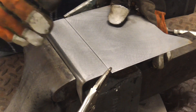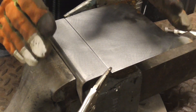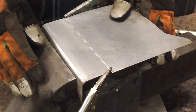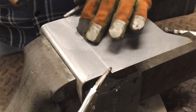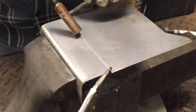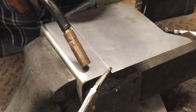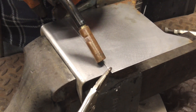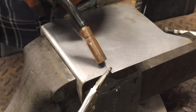Today I'd like to talk a little bit about lap welding, auto body sheet metal, and the one thing that I found made this job a lot easier for me through the years, and that is to use the lap as a guide to welding. When I put a spot weld on this lap, I'm going to run this welder right into that lap joint right there and use that as a guide.